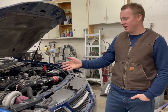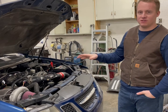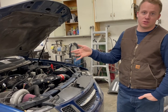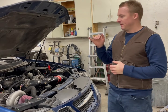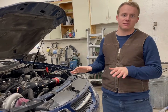My name is Logan Worthington and this is my mechatronics project that I've named IOSaver. The point of this project is actually for my project car. This is a turbocharged Chevy LS engine I've been working on in my spare time. The problem I've run into is that the aftermarket controller for my engine has a very limited number of inputs and outputs, so the Arduino will be supplementing that, helping me gain more diagnostics, more data, and more control over different parts of the vehicle.